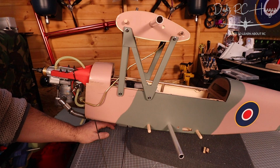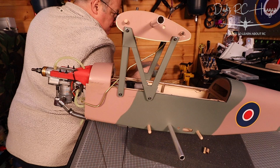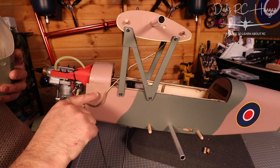Now, also, if I show you a picture here, this is the timing screw. All I did on here, I put an Allen bolt into there, and then you've got a grub screw that tightens on there. So when you're out and about, if I get the actual cowl, Simon, the cowl, yeah, have a look at the cowl. All I've done here is made a little hole, so this protrudes through it, so then you can just get the Allen key, which I think this is the right one actually, there you go, and just turn it safely. You can see I was trying to measure here, that I've got to get a bit of rubber on there